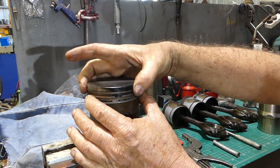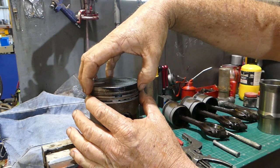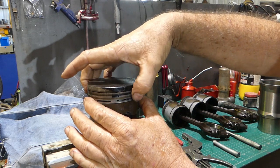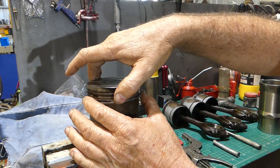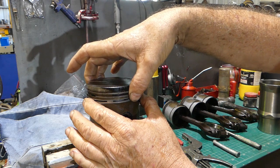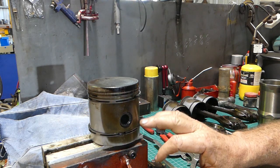This one here — the top ring — the ring groove in that piston is rooted. So it's just unreal. And then this next one down has less movement there, so you can see the difference. The top one has a lot more wear compared to the bottom one. This next ring down is an oil control ring, as is the bottom one.